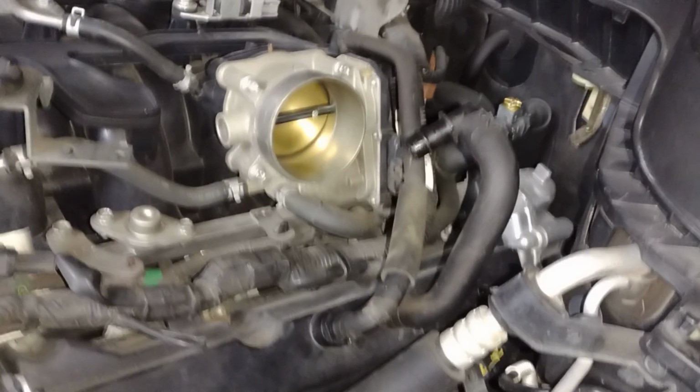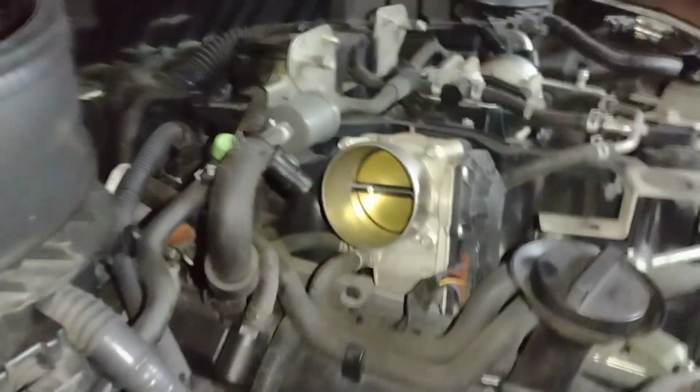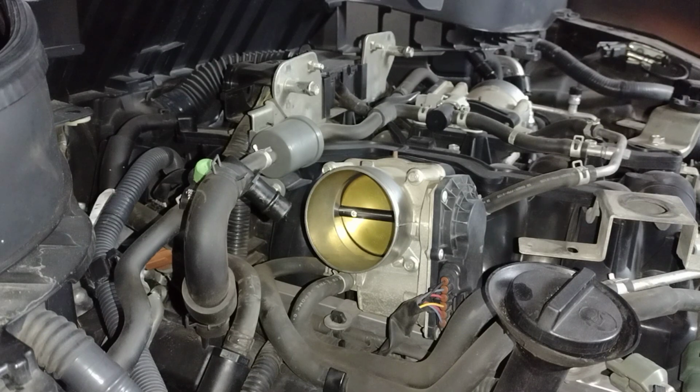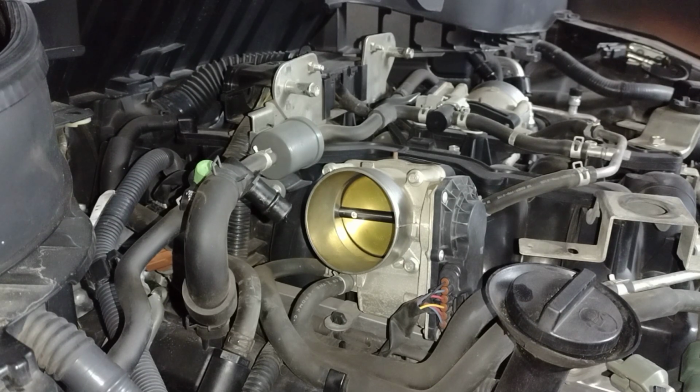And then, while at it, since I said some vehicles have one throttle body more active than the other, let's check out bank 2, which is the passenger side for the US, that is. Okay, let's repeat the same thing. Alright, position 1. Pushing the gas pedal. Jab. And then position 2. Pushing the gas pedal. Then turn it off.